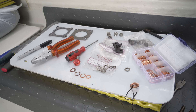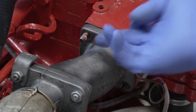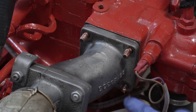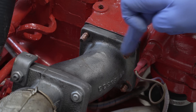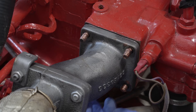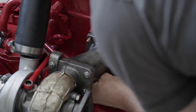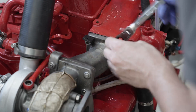This is where we get yet more serious with my set of various gaskets, washers, nuts, and so on. You will recall the copper greasing of the base halves of studs before the turbo went on — now it's time to make sure the other halves are protected too. Once satisfied we're suitably coppered up, we'll come to my choice of nuts. I had a choice of materials and designs: carbon steel nuts are likely to corrode even with precautions, brass is an option, but I've gone for stainless steel. We're going with Aerotite — it means I can go without spring washers and also without the need for Nordlocks. These Aerotites are expensive, but we only need four for this flange and four for the exhaust flange. On they go, and without forgetting the little brackets that need to fit onto the uppermost pair to support the turbo top cover.